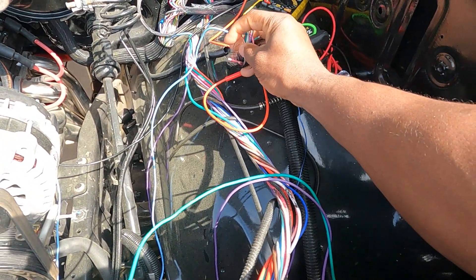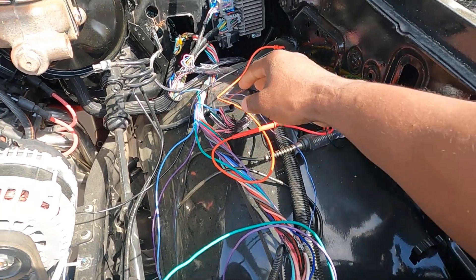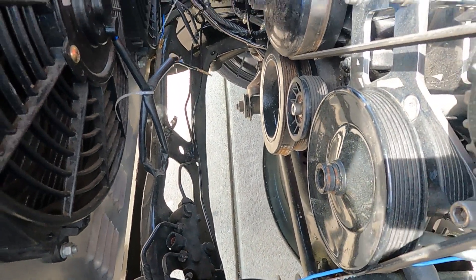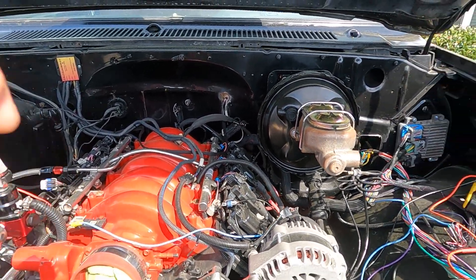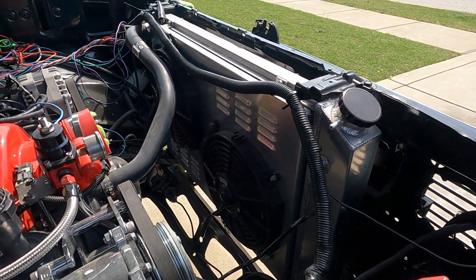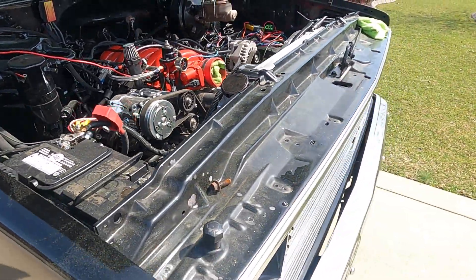I was trying to crank the truck but I see that this is a hot wire for the ignition side on one side and the hot wire for ignition on the other side — so a lot of stuff isn't hooked up. I've got to go through the wiring diagram and make sure all this stuff is hooked up as it should be. I'm going to put each of these fans on their own separate relay, both ignition sides probably on the same relay, and the fuel pump on its own relay. I've got six relays on the distribution block and I can hook more relays up somewhere else.